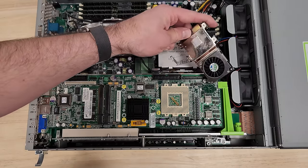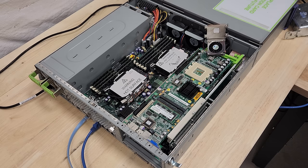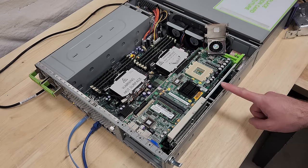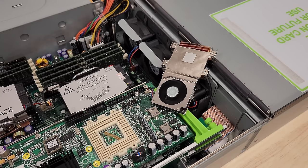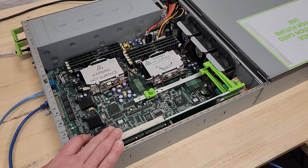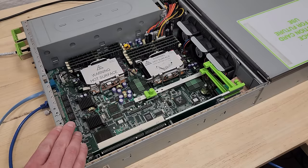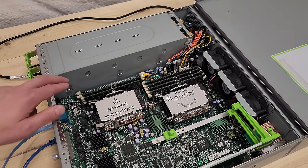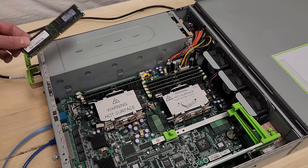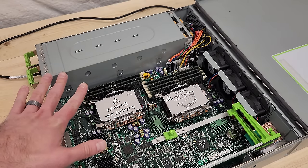There's nothing stopping me from running it like this — there are no rules down here. Serial management console so I can see what it's up to. PSU is on, so it should be booting to the LOM. That seems to work. It's going to turn off though — I don't think it likes not having a CPU in there. So we'll pull this, make sure the RAM's good, and come back to the card. Even with the Sun PCI pulled, it boots for a few moments then turns itself off. Let's pull our RAM — something with those new RAM sticks. This is a known good two gig stick — I'm going to put that in there. Yep, that booted just fine.